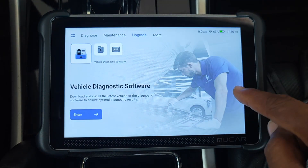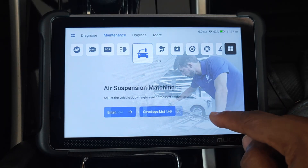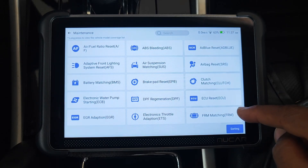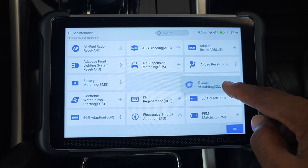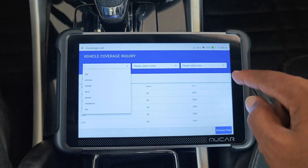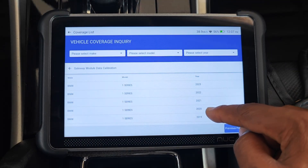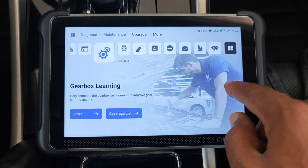The Upgrade tab is where you download all your free lifetime updates. The Maintenance tab — also known as service functions — has a total of 34 functions. Switching to the grid format, I like that these functions are arranged alphabetically. Not everything here will work on every car, since not every manufacturer has built in a service function for every system. Using odometer reset as an example, it supports only a small range of brands, so it's always good to consult the coverage list. I was able to initiate the ABS bleeding procedure on this Honda without any problems. I'll leave a link to the online coverage tool in the description so you can check what works on your car.